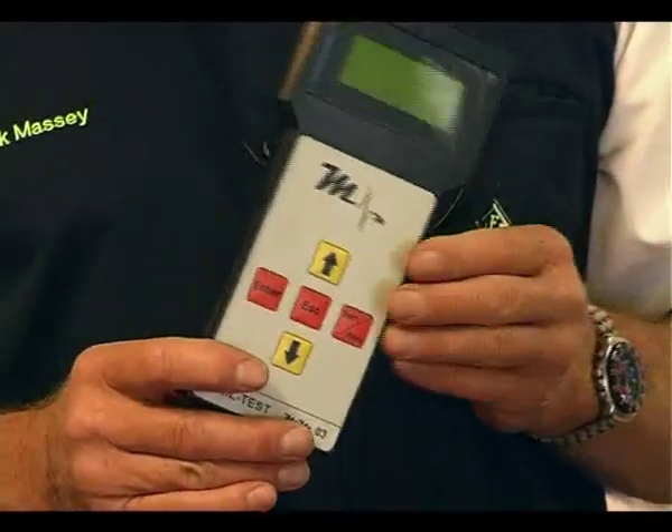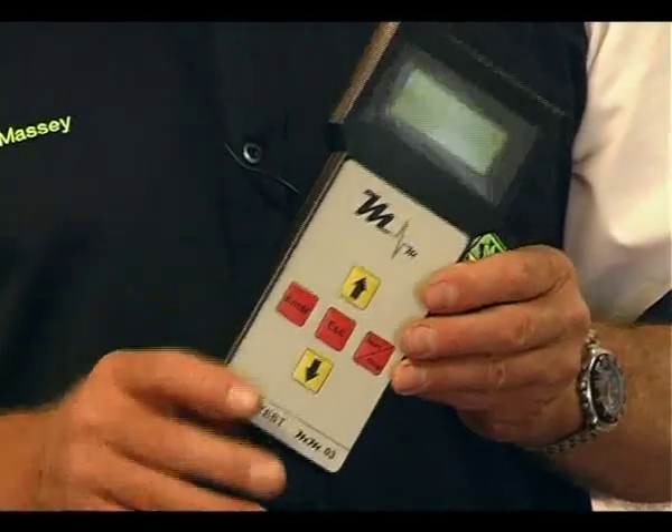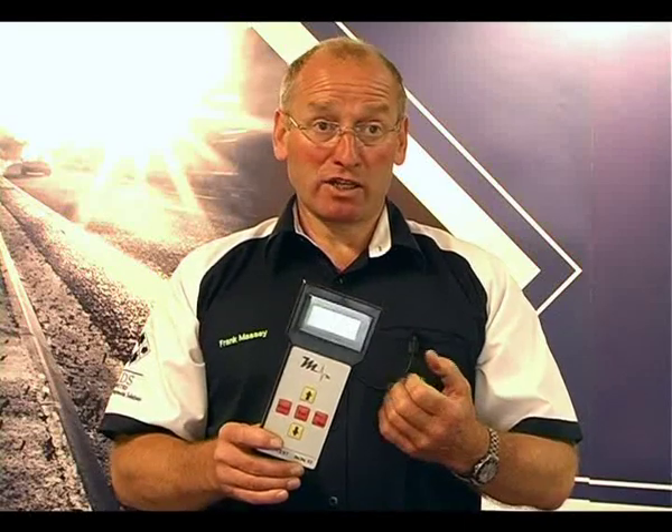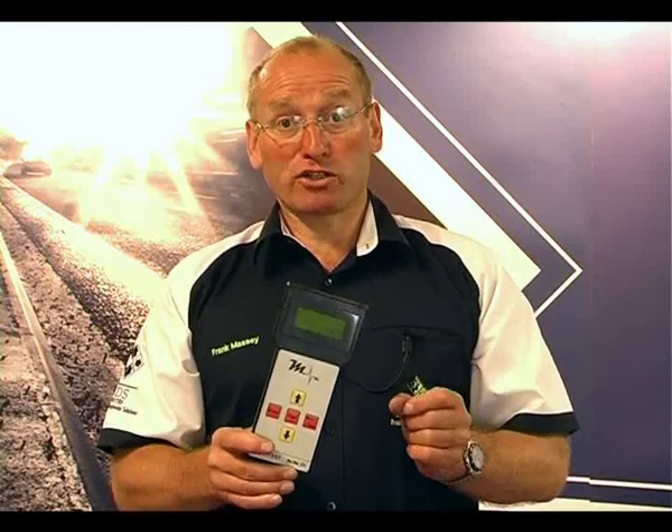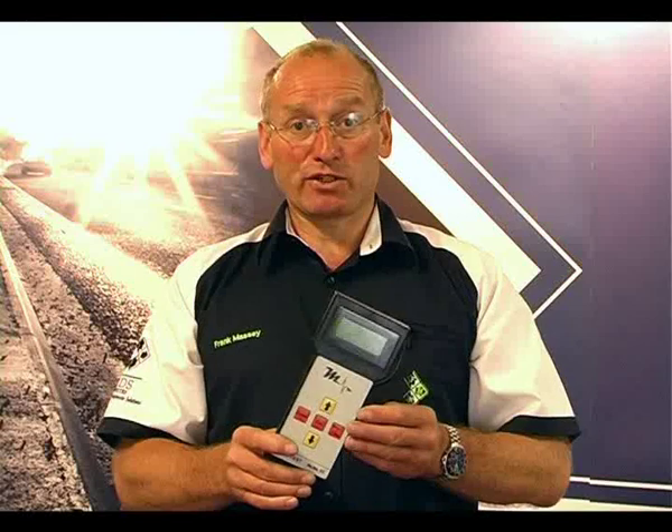The type of system we're looking at is what we call CP3, which has two devices which can be tested by this tool: a low pressure volume valve and a high pressure regulating valve — and both of those can be tested with this tool. We can also test the pump blind by disconnecting completely, and just having a look at the ability of this pump to generate a basic pressure purely from the return spring in the pressure control valve. So there's a number of tests we can do with this tool.